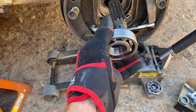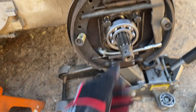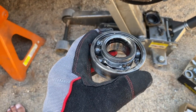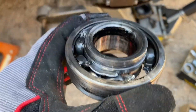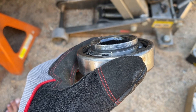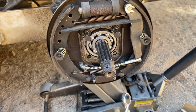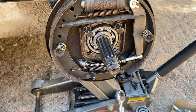This is what the new bearing looks like. It goes onto here and I'm going to gently fit it into the well where it goes — it's probably going to take just a little bit of tapping. On the back of the bearing there's a spacer with a chamfer on it too, and it fits against the axle, so when you put the bearing on that part has to go on first. It was a really tight fit, so I warmed it up with a heat gun and it slid right on and into place.